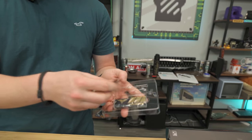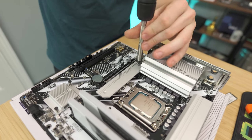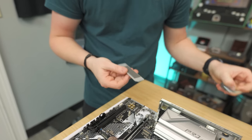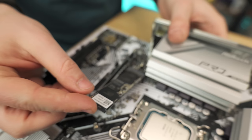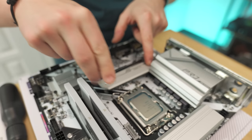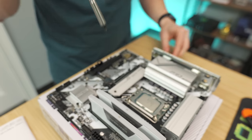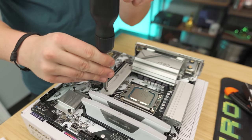This SSD does come with a nice big heatsink, but since the motherboard also comes with a heatsink, we'll keep it stock. We're going to use the topmost M.2 slot because that one has the most bandwidth and will run Gen 4. Take off the two tiny screws with a PH1 Phillips, peel the thermal pad, and insert the NVMe at an angle then push down. In this case the M.2 heatsink holds it down, so just get both screws in about halfway before tightening — finger tight is sufficient.